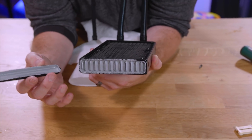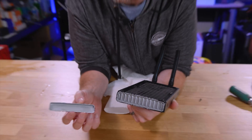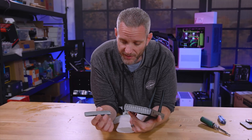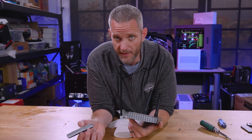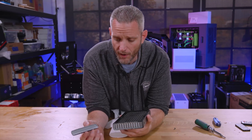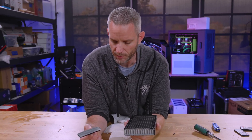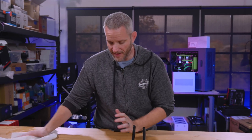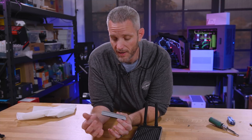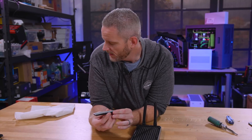The most important lesson to be learned from this video: if the coolant is designed to handle mixed metals, then you can actually mix metals. Still not recommended, but you could mix metals and have long-term success with it. Had this just been distilled water without any anti-corrosive agent in there, this would have gotten algae growth and would have also corroded on the inside. This doesn't mean that AIOs don't corrode — it's up to the manufacturer to use the right coolant chemical configuration. If the chemical makeup isn't proper and there aren't the right anti-corrosive additives, you would certainly get different results.